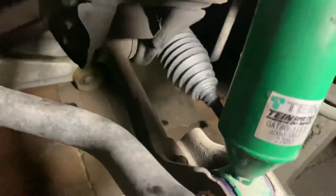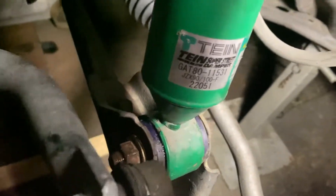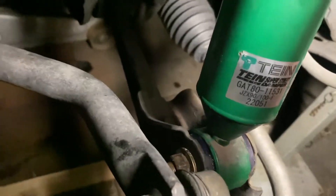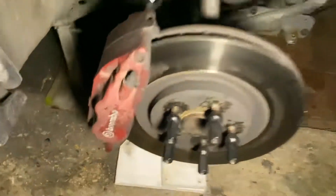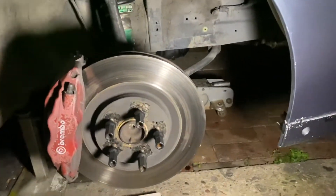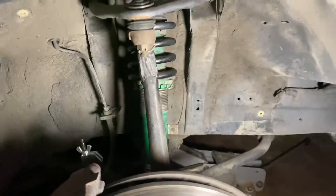Also what I just did — see the bushing at the eye of the shock? They often collapse too. I've just recently replaced those because my car had gotten so low on this side that it had bent the guard out, which is very frustrating. But yeah, that is JZX-90, 100, and 110 front suspension setup.